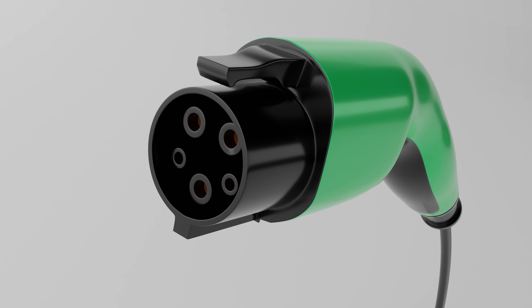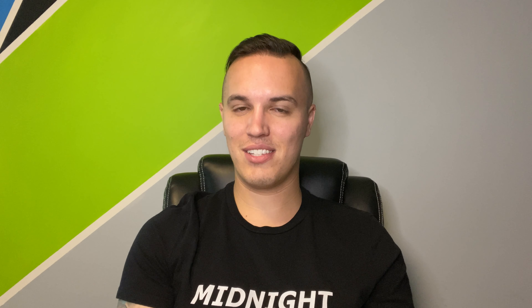Let's start with the basics regarding charging standards. The very first charging standard you should know is what they call the J1772 — you can also call it a level 2 charger. The J1772 is the most common charging standard here in the United States. You're going to find this mostly on home charging stations as well as public charging stations. The majority of electric vehicles come with this standard, but there are exceptions such as Tesla products, which do not come with the J1772.